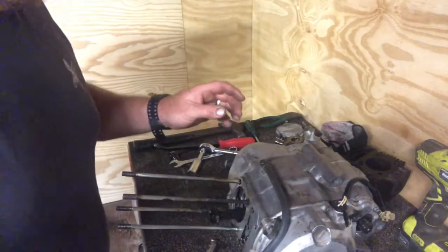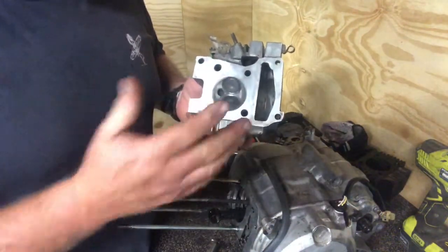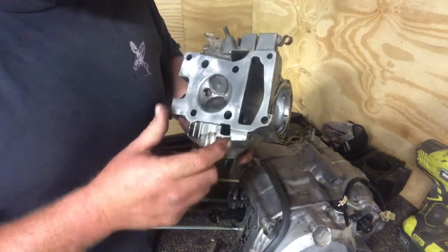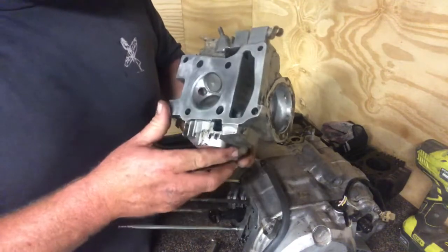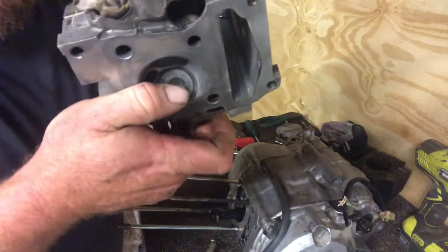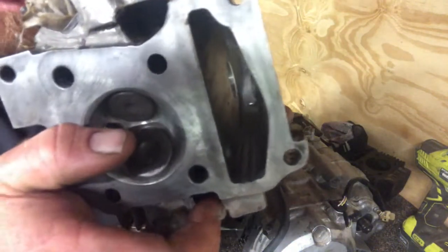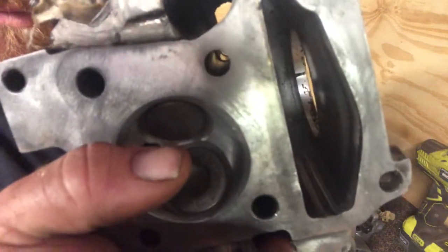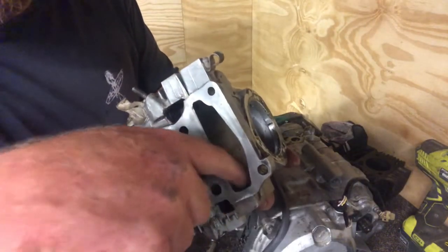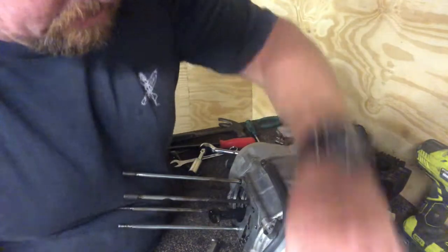The reason I know that — it just confirms it — is I've cleaned up the bottom of the head. It was all black so I just cleaned it up to get a good silver gasket surface, and I cleaned the valves up just to check their condition. When I did that you can see in there — train tracks running through. That's where the cam chain has actually been rubbing on the casing because it's been flopping around so much. It's actually worn two grooves in there.